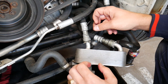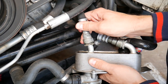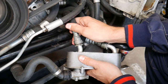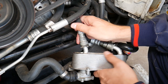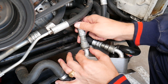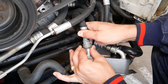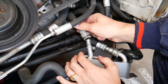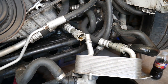Once you're done with that, grab the hose — you can see the hose moves a little bit. It will be a little bit hard but it moves a couple millimeters. Push it all the way in and keep it in. Now, compress that fitting evenly on each side while you're pushing the hose inward, and at the same time start pulling the hose out. Once it jumps that lip, you can let go and just pull the hose out.